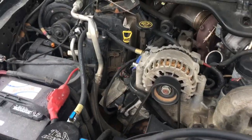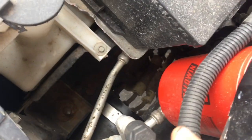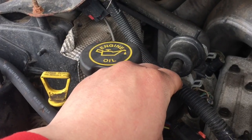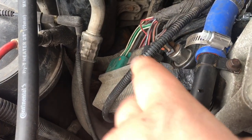The first thing you're gonna want to do is remove your intercooler pipe. I like to remove it at the turbo and then at the intercooler — it's just an 11-millimeter bolt at this point. I do have a coolant filter here so that's gonna make it a little bit of a pain. We are gonna have to remove our boost tube here, get that up out of the way, this piece that goes right there to this valve — undo that and put it up. Then our glow plug connector right there — we're gonna unplug that and get that flopped up out of the way, and then both of our harnesses here, the ICP and the glow plug control module, all that will come off.